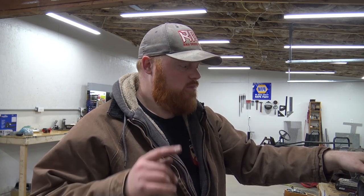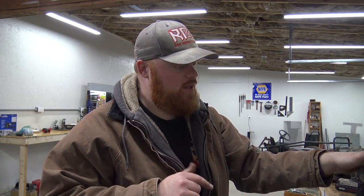We're going to clean the block out really well. We're going to go ahead and remove the governor on this engine and put 18 pound valve springs in it. The same old jazz we always do. We'll clean this engine up quite a bit and then put it back through its paces. Seems like everything else is okay. It probably wouldn't be bad to pull the rod out, check the rod, and pull the piston out and everything, but the engine did not smoke at all. It did not make any strange noises.